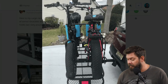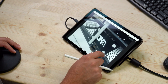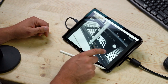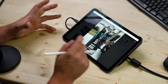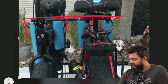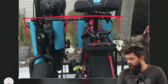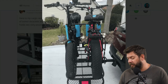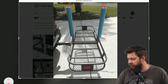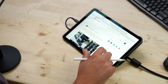Here's another rack for e-bikes. This is converting a trailer hitch basket to accommodate two fat tire e-bikes — you can see them there. The conduit is just bolted to the basket, really simple. The trick was being able to separate and have the two e-bikes stand upright. There's a yoke they created that separates the e-bikes and keeps them upright and stationary. They used fat pool noodles as padding — a really simple solution to this problem. The T connectors attach right to the top of the conduit pieces and hold everything together, making it all sturdy. Thanks, Michael — love seeing that.